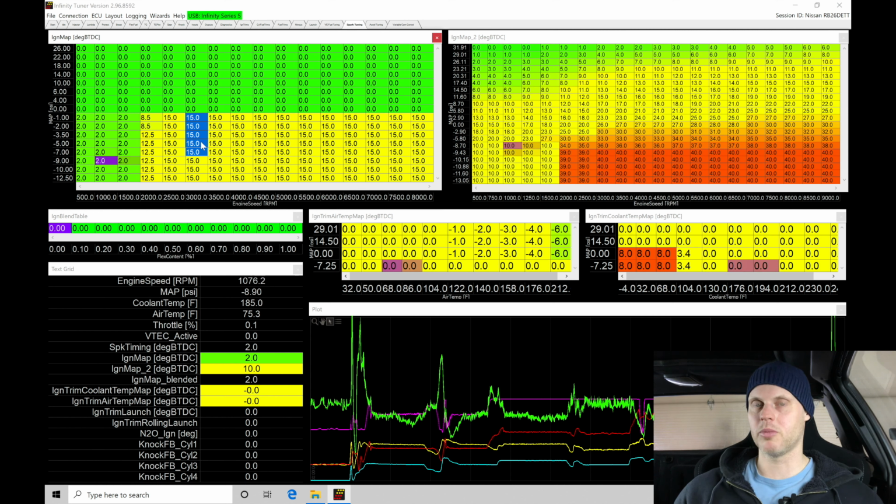So you can repeat the same process. It's a little bit more involved and time consuming within the part throttle spark timing calibration, but you'll find that you can do it. It is something that is a possibility. So what I'm gonna do right now is drive it, hold it at 2,000, 3,000, 4,000, maybe even go up to 5,000. I'll see how far I can get as far as the RPM goes, and I'll vary the spark timing, just bumping it up from this point and then seeing where we peak in our torque.